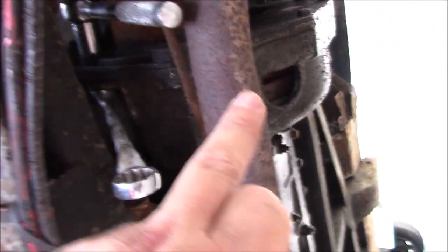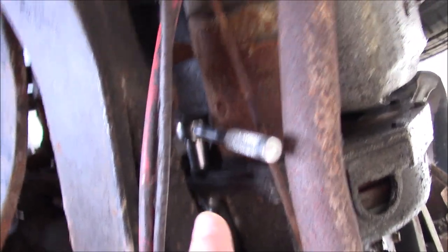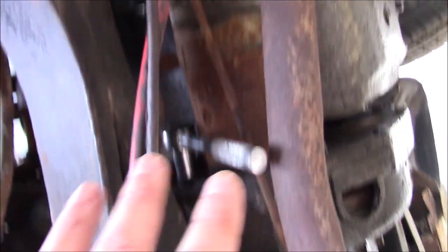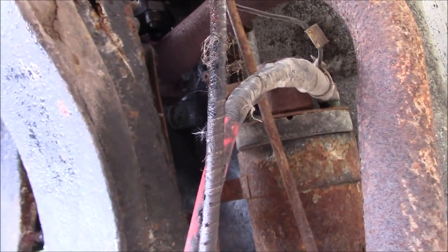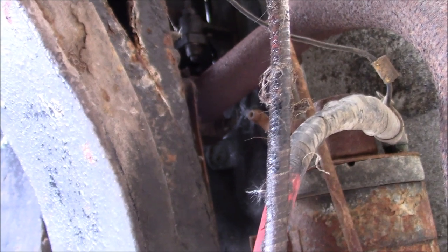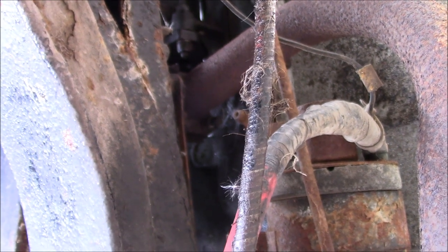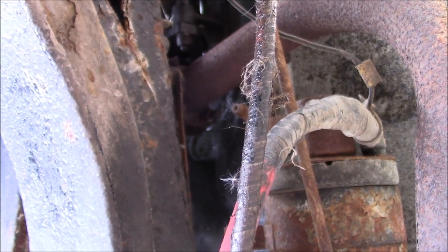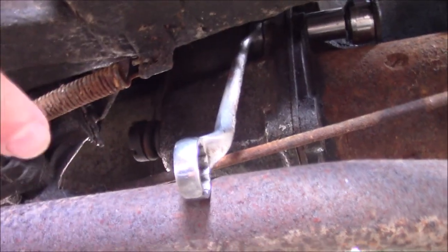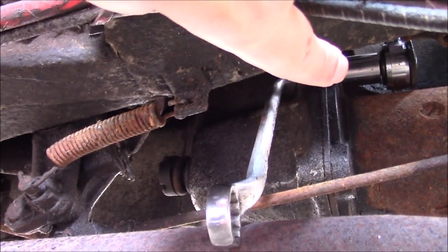The exhaust is stopping me going the other way. I had been warned when you remove the starter motor that you do have to remove the exhaust by other people that have done it. I thought I could get away without doing that, but it looks like they were correct. The exhaust is a couple of bolts way up there, which I can't see how to get to from underneath the car, so I'll have to get to it from the top, and to get to it from the top, I have to take the carburetor off. Next day I've got Pat to help me. I'm underneath the car, so I'm on spanner duty. Pat's on ratchet duty, he's above the car.